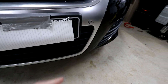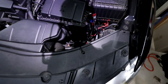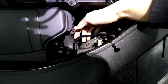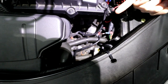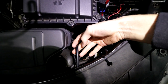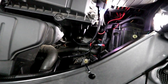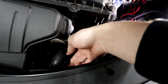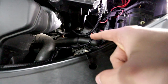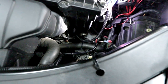While you've got the grill out, you get access through for a wire. The wire from the light bar comes up through a little hole somewhere about here that you can pass a wire through — and in here is where the wire comes in. On my R36 there's a bit of a mess because I also have DRLs installed, so that's another wiring addition. The high beam wire comes in from the front of the grill, and the negative goes down to the grounding point just down here, which is also where the ground for the relay goes.